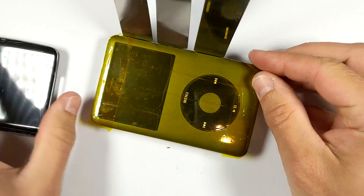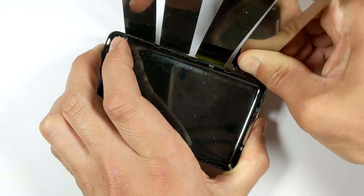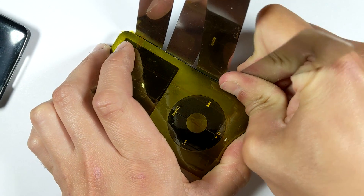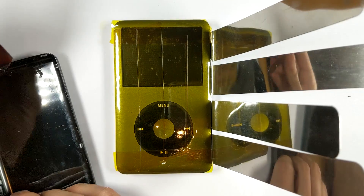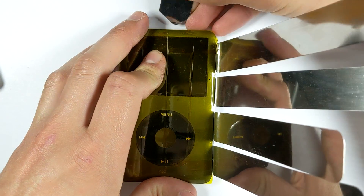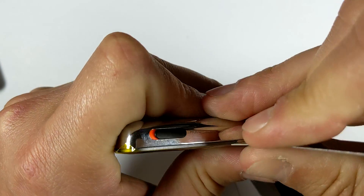There's a good tutorial by Elite Obsolete Electronics on how to do this as well — that's actually how I learned. One thing to note: although we've got the Kapton tape down to prevent scratching the screen, it's very difficult to not scratch the paint off the front plate along the sides. On a gray or black one you might see some visible marks from where you inserted those tools. It's a lot less visible on the silver one. If you really don't like that, you can get a new front plate — they're readily available on my website, eBay, and AliExpress in all different colors.